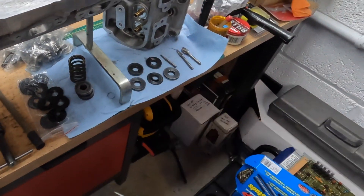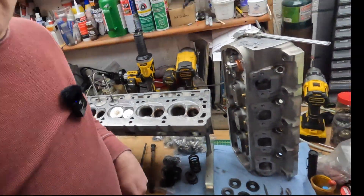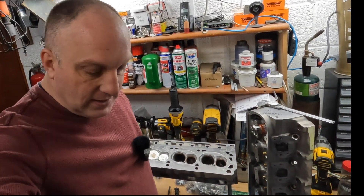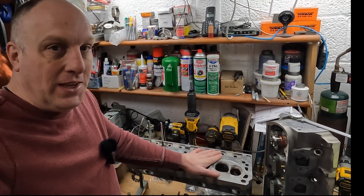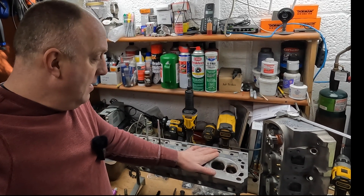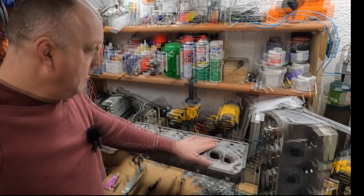There was one here with a little peck mark — something went through and dented it — so I'm going to have to take this one down a little bit. But all the ports are nice and blended, no complaints about that. All these intake valves are going to need that 45-thousandths ridge right at the edge of the seat taken out, and all this hardware and all these springs are going to go bye-bye.